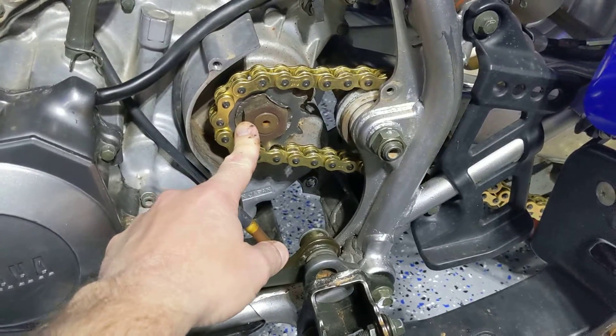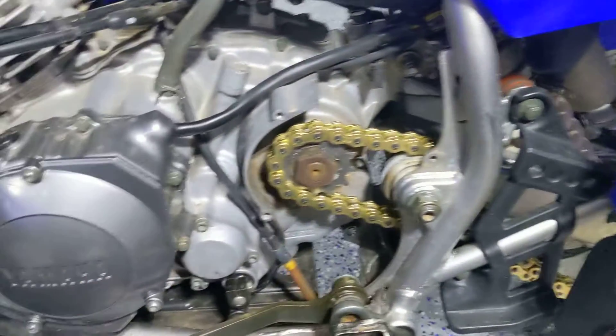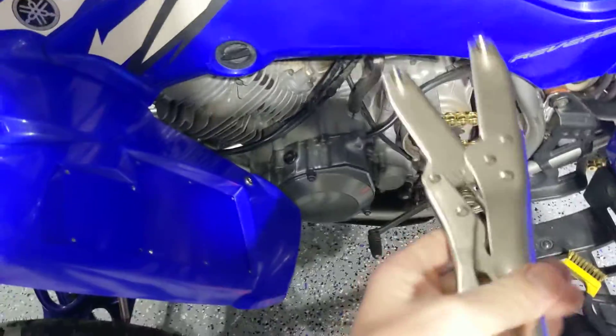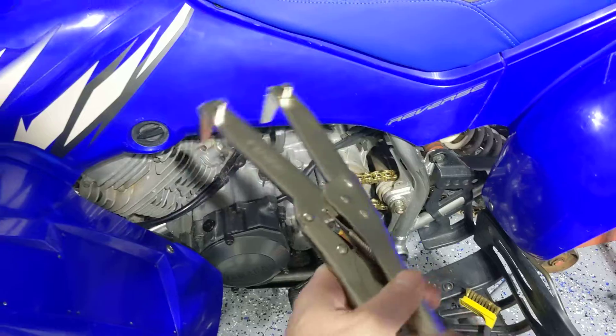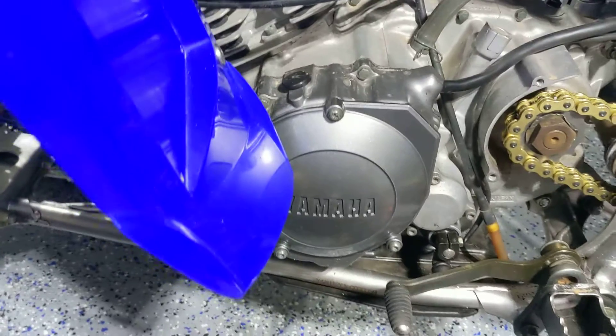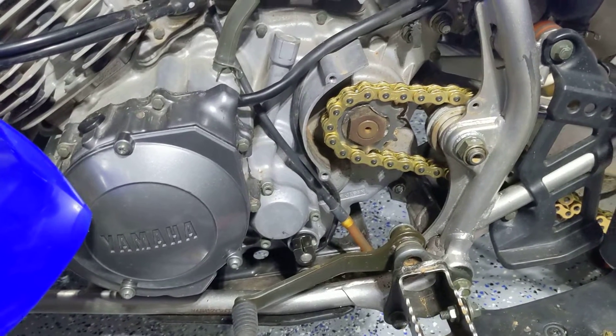When you're putting the front sprocket on, torque it down to about 55 foot-pounds. I put it in gear and you can get it most of the way tight with a good torque wrench, but then it's going to start turning on you, so you're going to need something to hold it. Before you put the chain on, with the sprocket exposed, I used the Tusk clutch tool from Rocky Mountain ATV. You set it so you can put it on either side of the sprocket, clamp it down with the vice grip-type handle, and then give it the extra crank on the torque wrench to 55 foot-pounds.